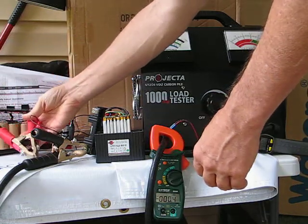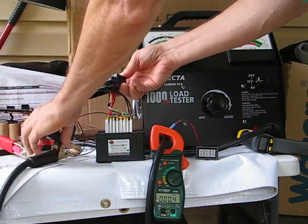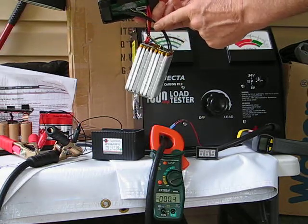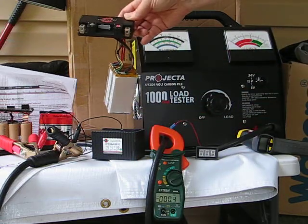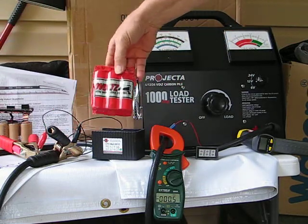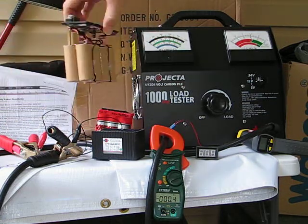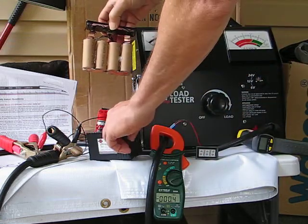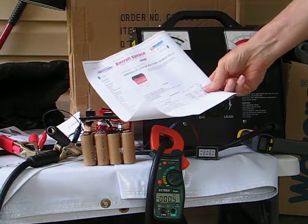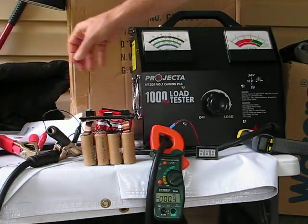Okay, let's do the second battery. Now about this battery — these are 16 gauge wires, prismatic cells. It's quite hot — motorcycle battery, let that cool off. Here's your second one: this is an Aerovolts 8-cell. You can tell I took it apart — here are your 8 cells. This is a 5 amp hour battery, and it claims, according to the sheet here, 275 cranking amps. We'll find out about that.